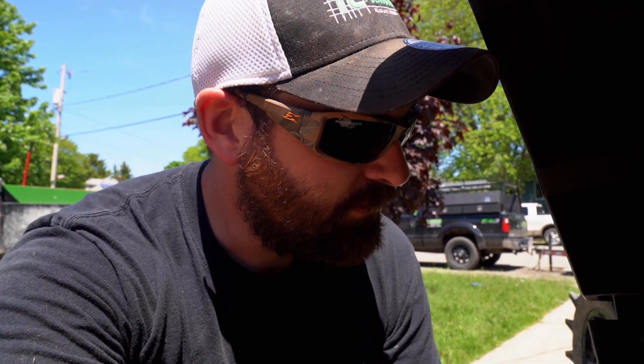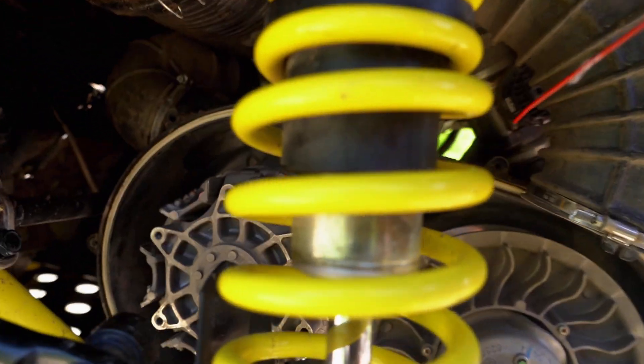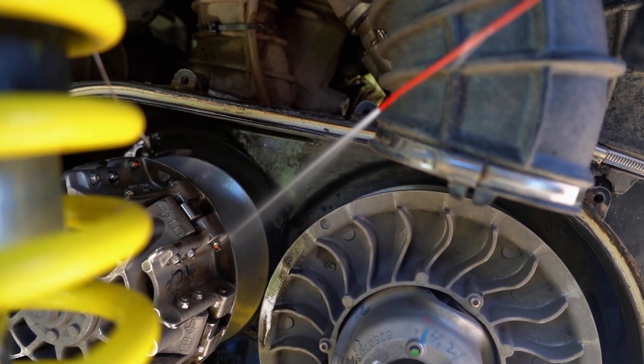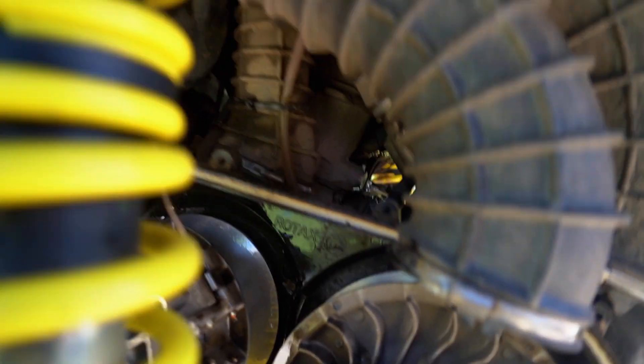Can't find my air chuck, so we're going to go a little redneck on this one and just take it until the compressor builds pressure, then we're going to blow the primary and the secondary clutch with a little bit of air to make sure we get all the dust out of there, because dust will slowly ruin your clutches as you should know. So we got the clutches all blown off now. We're going to spray them up a little bit with brake cleaner — any sort of residue — and wipe them down with a microfiber. Then we'll be ready for the new belt.